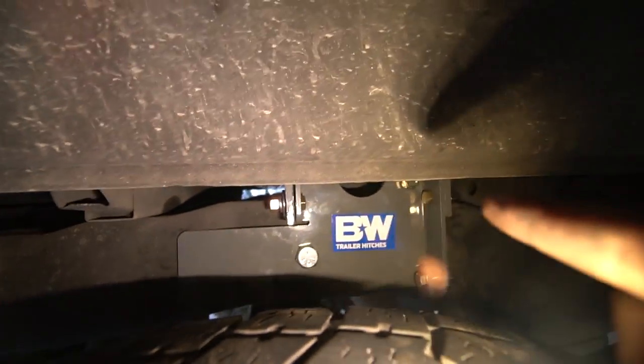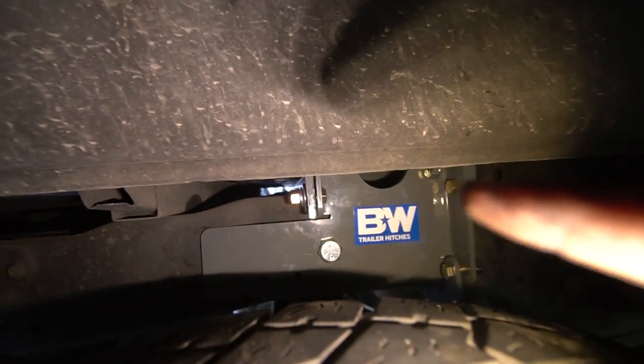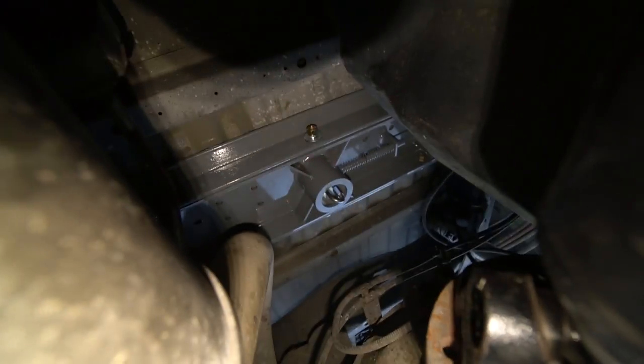Oh, you got these side plates and then the pieces of angle there and there. Those are the hardest to get in. And then getting the center section in required dropping the exhaust down. I'll show you. I had to pull it out of the joint here and then drop it down to get that center section up and over it. And we will have to space it down. It comes with a bracket for that. But anyway, now we just gotta tighten all the hardware for it and finish putting the last little pieces on.